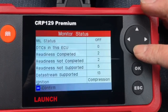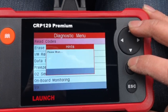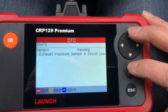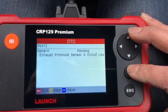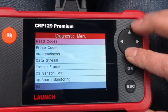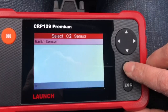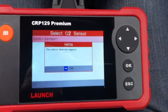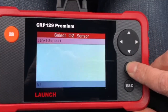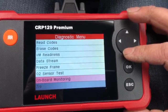You've got no DTC codes, which is good. Readiness completed, readiness not completed, supported data stream — it's like a monitor status. Let's see if we've got any codes. It scans the whole ECU. Exhaust Pressure Sensor A Circuit — load pending. So it's stored it, it's telling me there was a problem. Let's do the sensor tests — it says it doesn't support it, probably because we've got the DPF pressure sensor instead. You can see it's got onboard monitoring.